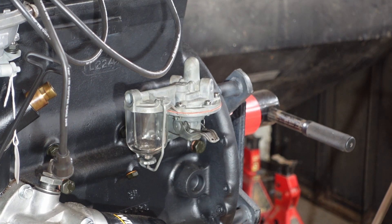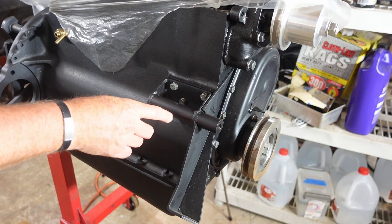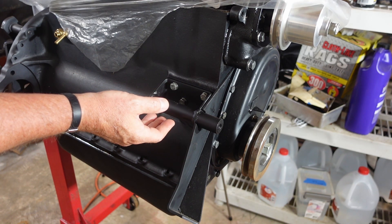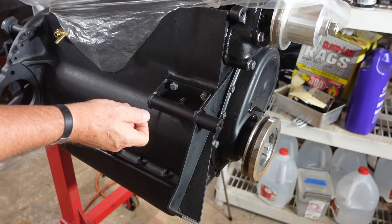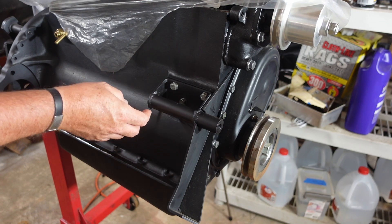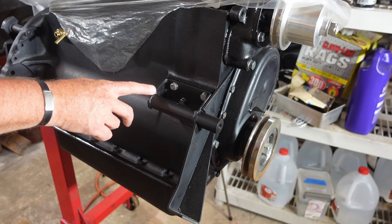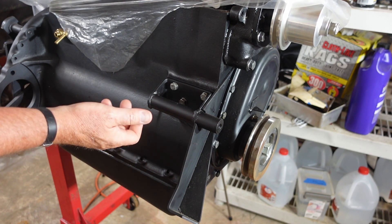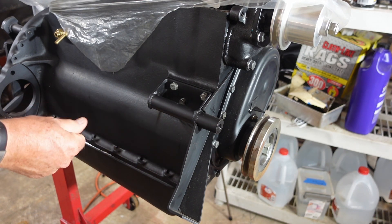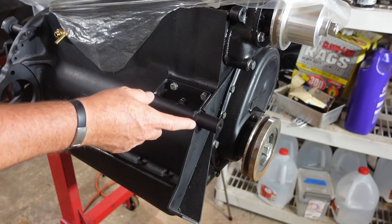Now up is going to be the alternator, and this is all aftermarket stuff here, so it probably is going to be a challenge like the rest of my aftermarket stuff has been. That didn't take long to run into difficulties. So this is the bracket — it gets bolted to the side of the block for the generator or the alternator. What's going on here is this has been welded. This shaft here, or this tube, it looks like it's been welded to the bracket. I didn't really recognize this as not being stock because frankly, the welds aren't always that great from Triumph and these welds are looking okay.